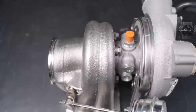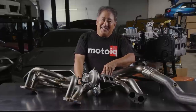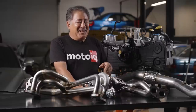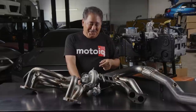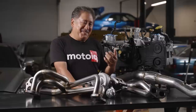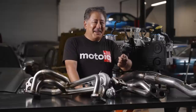This is a big-ish housing for a 2-liter, but the twin scroll kind of makes up for that. The bigger the A/R you have on your turbine housing, the less back pressure you have and the more peak power — the disadvantage is more lag, because A/R kind of works like spraying a hose at a pinwheel. If you put your thumb over the end of the hose and spray really hard, the pinwheel spins up sooner and quicker. A small A/R like 0.60 or 0.48 is like putting your thumb over the end of the hose — quick spool up, but then it's restrictive and you have a lot of back pressure, so you lose top-end power.